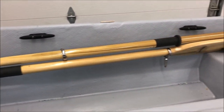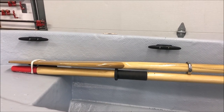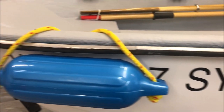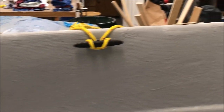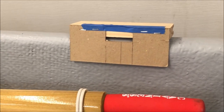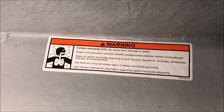There are some cleats on the seat so we can secure the oars while underway. We're going to power it with the two-horsepower outboard. I put in a series of six cleats that will allow me to flip fenders over the side so we won't bump into the Catalina. The name and registration numbers are on there — bought those from Boats US. I made up a little jig to space all the cleats the same — just a piece of cardboard stapled to a block so I could get all the screw holes the same distance down without measuring over and over again.